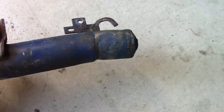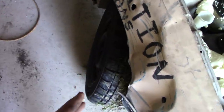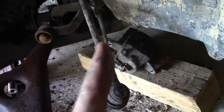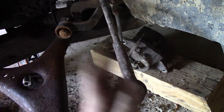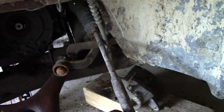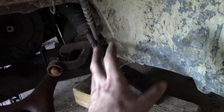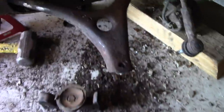Some of the bend was hidden inside the actual connector. The passenger side seems okay — it's got the rim and tire mounted, and that rim looks pretty straight, not leaning in. I think most of the damage was on the driver's side. There's also something funky going on with the steering — the tires won't point the same way; one is always about four inches off from the other. But it looks straight on both sides even up under the boots. I'm hoping that means it was just because of the struts being collapsed and twisted, preventing the steering from working to its full potential.